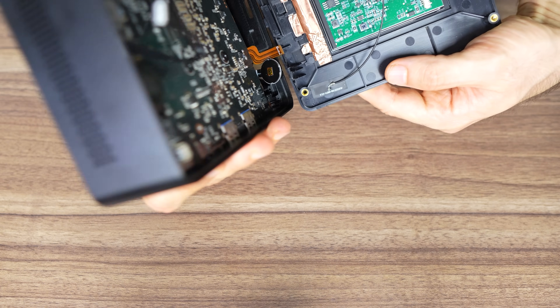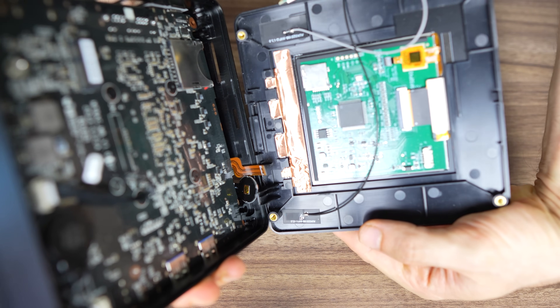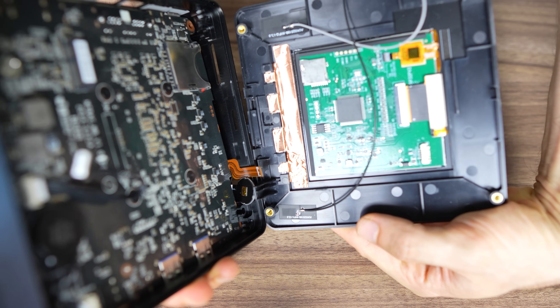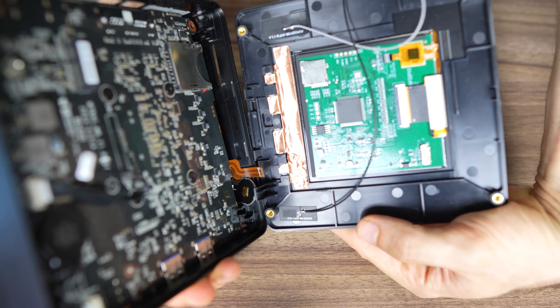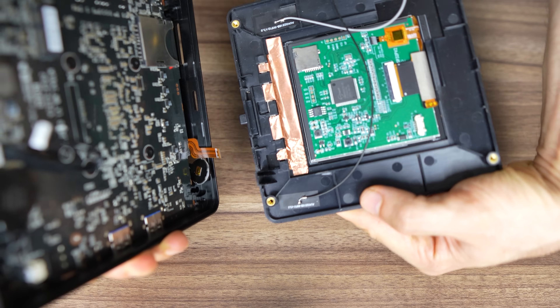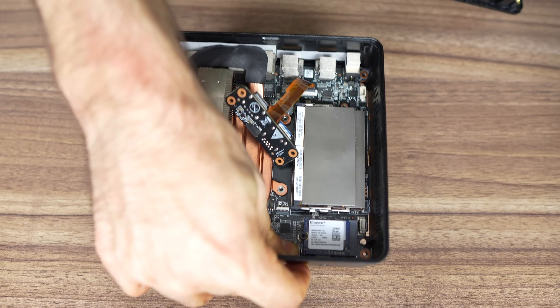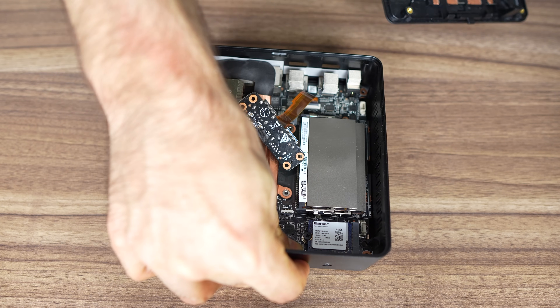Be careful not to pull out the camera ribbon cable off the board, as it's impossible to put back in. With the board slightly out, you need to pop the top lid and juggle the items. Even though that happened during this review, Minisforum was kind enough to replace it so the camera could be tested. That said, it's not a great design.